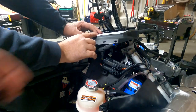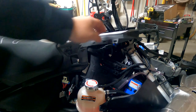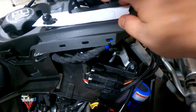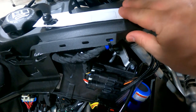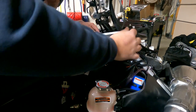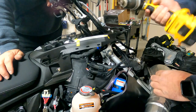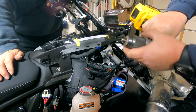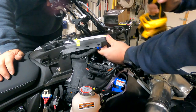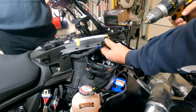So we got our template that we cut out and printed from instructions.brp.com. There are four holes — you want to drill here, here, here, and here. We're going to get a little piece of tape just to hold this down. Before the centering drill, we're just using a really small bit to drill out these marks. Then we'll use the centering bit, and then we'll finish off with that 6.5mm drill bit to be a little more precise.